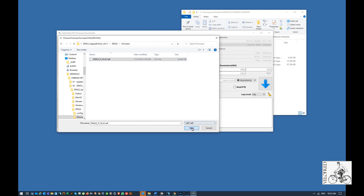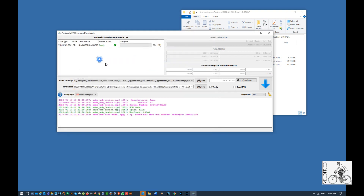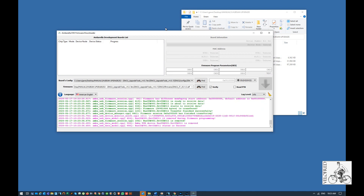Then you find the configuration file on the top. I think this update is for the gimbal only — checking the upgrades, it looks like only the gimbal was affected by this update. Once everything is done, verify everything is correct: correct drone, everything is ready. Press the blue arrow and wait for the update to load onto your drone. When it's done it should say success. It goes pretty quickly. Status is success, everything is good. We're ready to move to the next step.